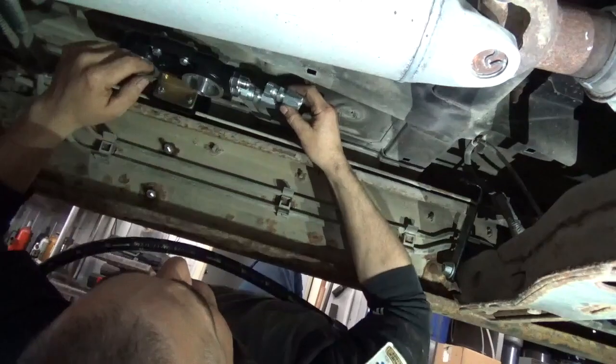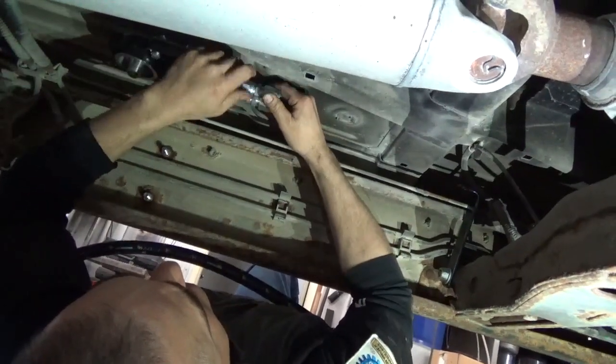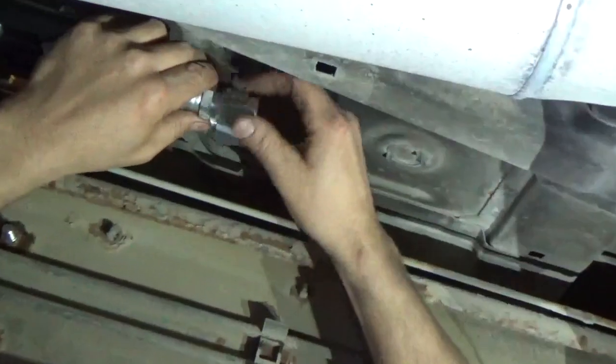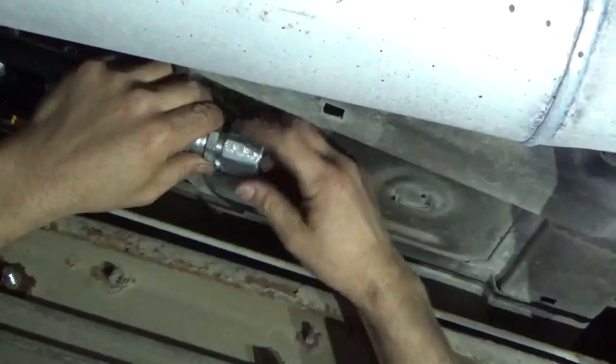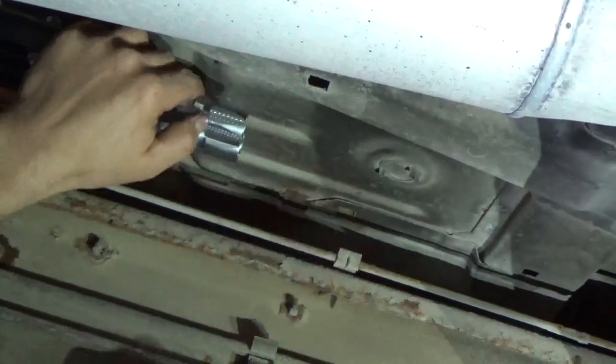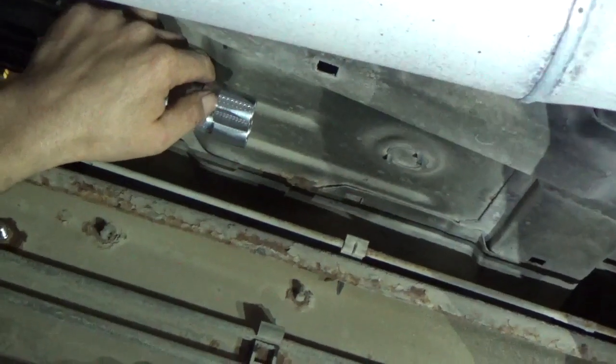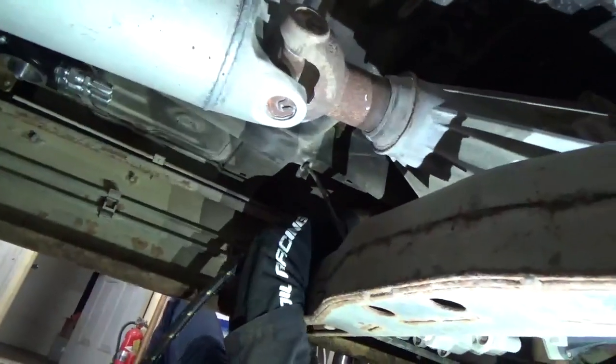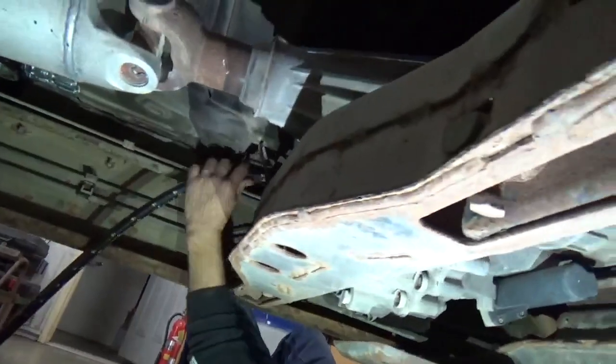Okay, we're going to measure for cutting the hoses. We're going to put these fittings on when you put them on all the way. And also these back parts, make sure that they're screwed on all the way, because we're going to measure right up to where that hose goes, which is about right there where my thumb is at. I've got one of these assembled, and we're going to take that and bring it on through here by the brake controller, analog brake controller.